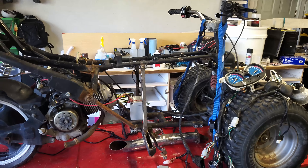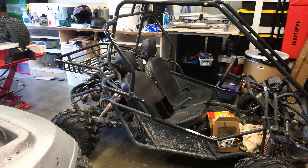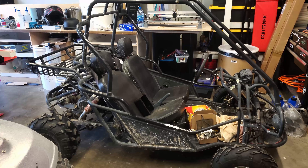The next project I've got is this go-kart I picked up. It is a Kandy KD 150 FS — it's got the 150cc GY6 motor in it. When I picked it up the people said they thought it was an electrical issue and couldn't get it to run. I started digging into it and actually the timing chain skipped a gear and made a valve impact the piston. So I tore into it and replaced the piston out of a spare GY6 I had here, but it didn't help, so I just said screw it — I'm buying a whole new motor which hopefully will ship this week.